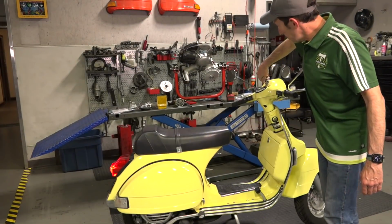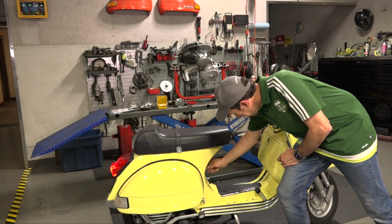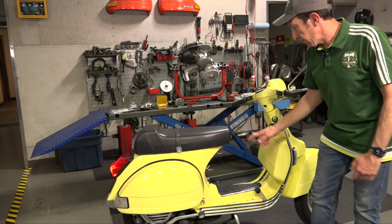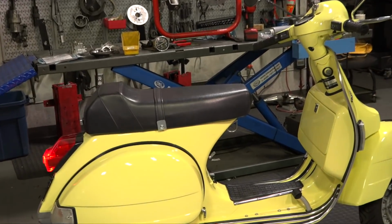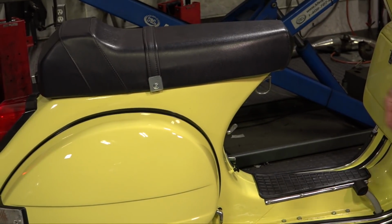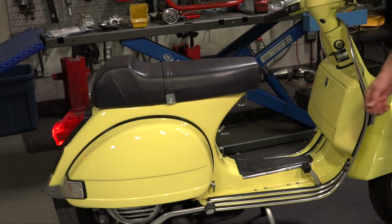So turn the key on, see the tail light comes on these American market scooters. Will turn the fuel to the on position, which is straight up. It does not have the original plastic American fuel tap on it. It's got the far superior European style lever, a conversion kit that actually blocks off the plate for that rather large plastic fuel lever. If you look at my Rally 200, I've talked about and reviewed in my past videos.